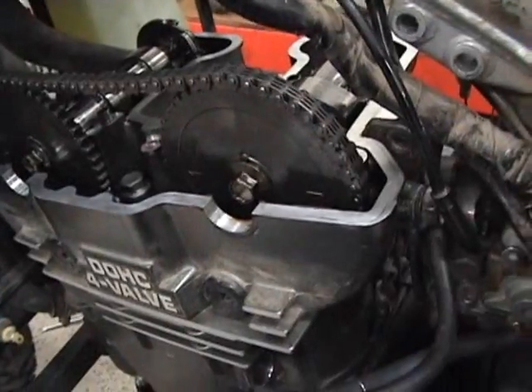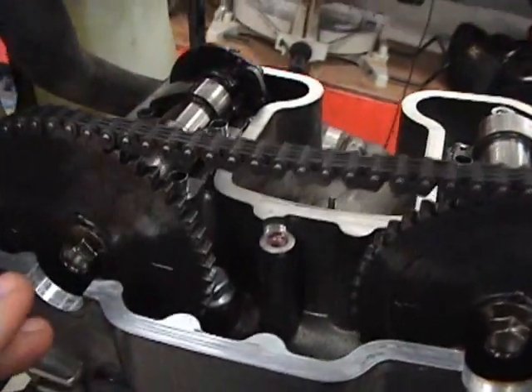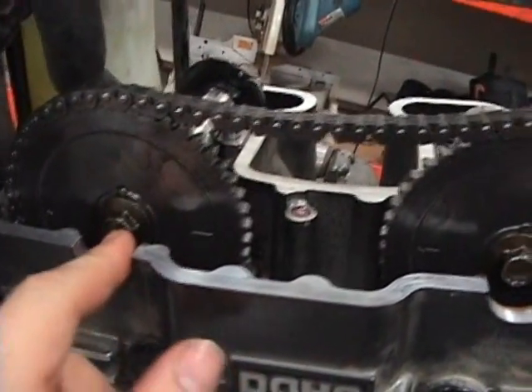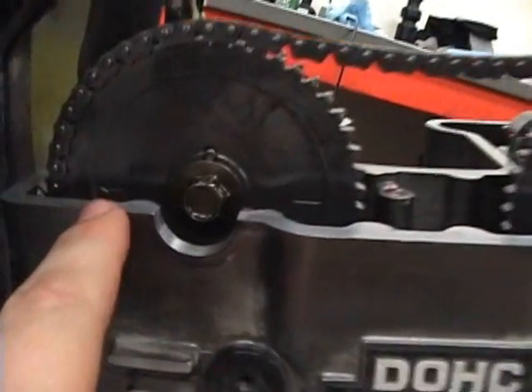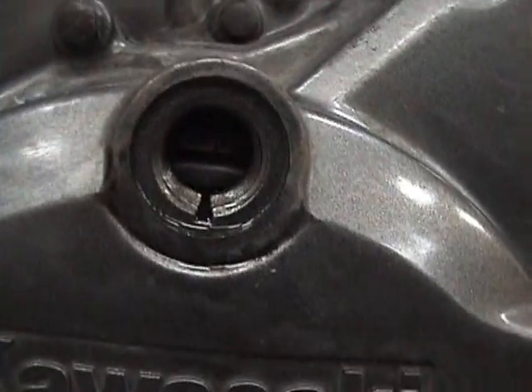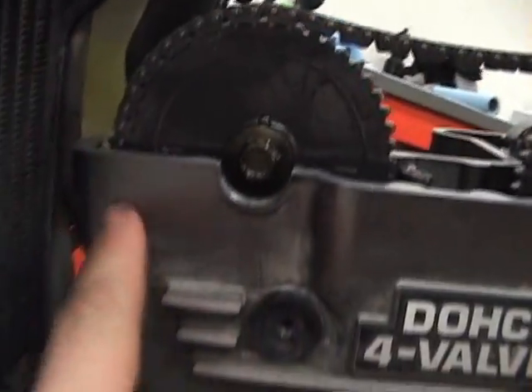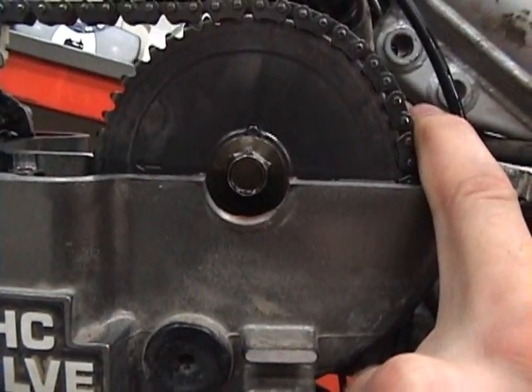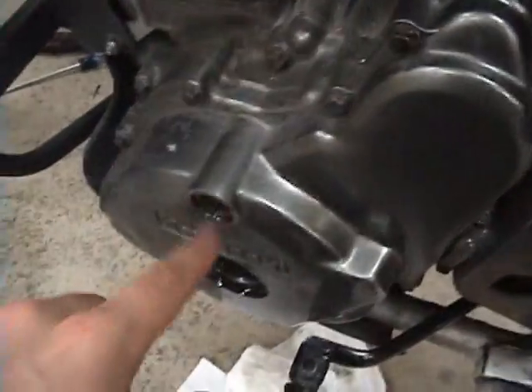Time to reinstall the cams. To reinstall the camshafts with the chain supported by your wire, put the front one — the exhaust one — in first. You want both arrows on the outside to line up with the edge. With the engine still at top dead center and the chain on this side pulled taut, the top part of the chain should be level. If the engine's at top dead center and both are level, all four cams are pointing outside — you've got it timed correctly.